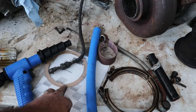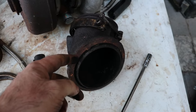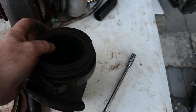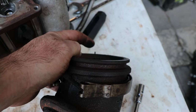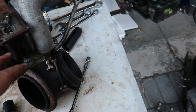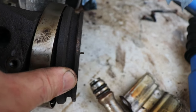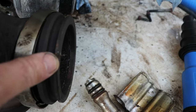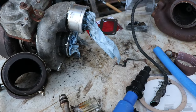You do need a gasket for the back of the elbow. I chiseled off the old gasket and clipped on a new one. There's an indicating dowel on here — these are quite fragile. I whacked it with a hammer to get it off the truck and then had to straighten it out afterwards. The other one had its nub bent pretty good and it's off by its entire diameter, so I'm hesitant to use that one even though it's a bit lower mileage.